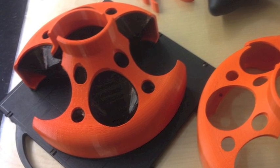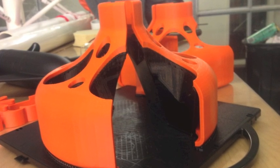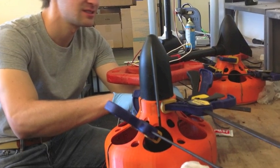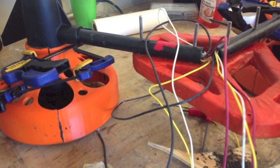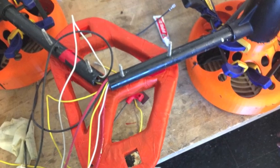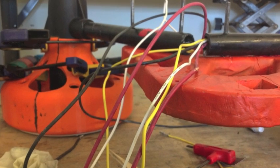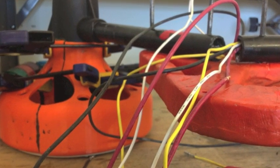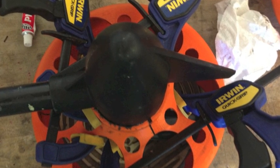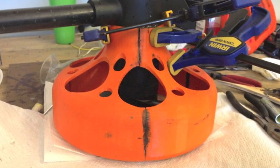We put the polystyrene cork below both holes we drilled in the shaft, then put spray foam on top of the cork. After we let the spray foam dry for a couple of hours, we would put a small amount of epoxy on top of that spray foam, let that dry overnight, then come back the next day and put the rest of the epoxy in — making sure to put the two screws through the holes we already drilled in the shaft so the epoxy didn't block our way through there.